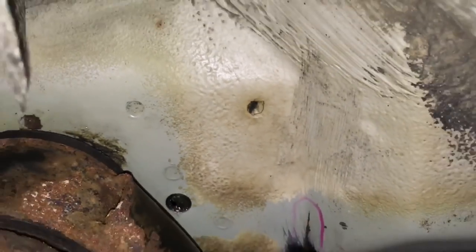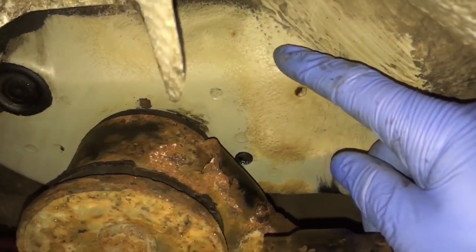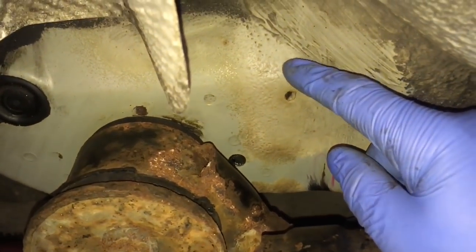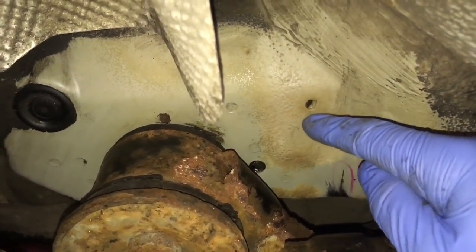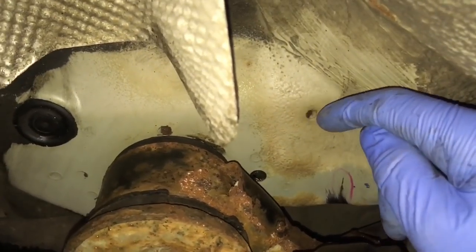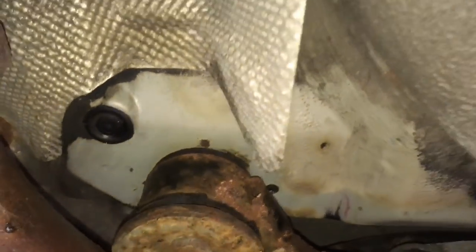Just zooming in so you can see the difference — that's a good spot weld and that's a bad one. Quite a jagged, nearly circular line around the edge where the metal is fatigued and broken, meaning the rear axle carrier panel internal cavity cover panel isn't now connected to the rear axle carrier panel at that location. Sometimes that's where we see the spot welds break and then cracks introduce and climb up a vertical section inside the car.